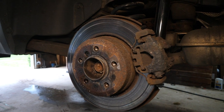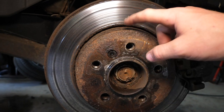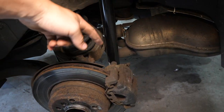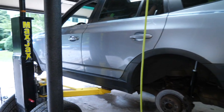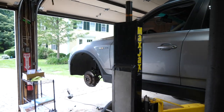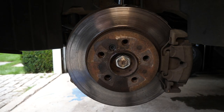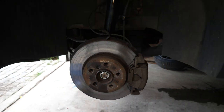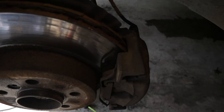Here's a look at the brakes — they're really nasty right now. I went around and hit each brake on this screw right here that holds on the rotor. I hit that with PB Blaster as well as the two bolts on the back that hold on the caliper. I've done that to all four brakes, just trying to get those loosened up because that is going to be an area of difficulty — at least it was on my E90 when I did my rotors. This little screw right here was a real pain, so I'm hoping we have better luck today.